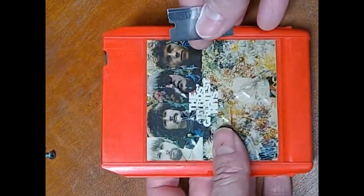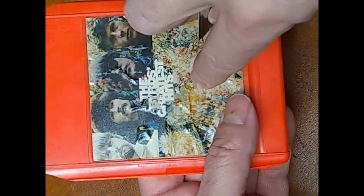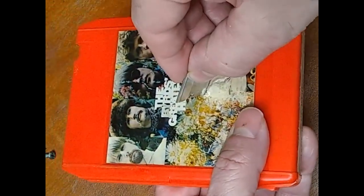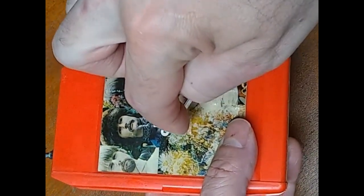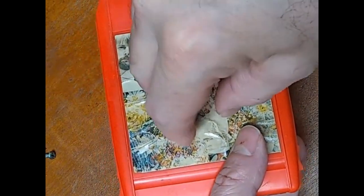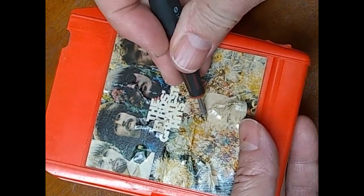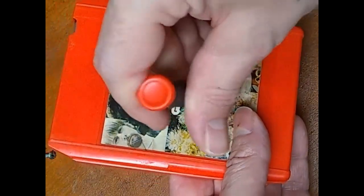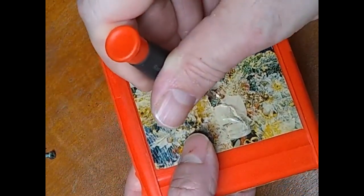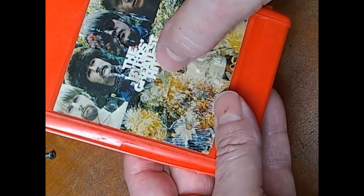I'll show you that one more time. Take your straight edge razor where the hole is underneath — that's where the screw is. Take the tip of it, push it in so that it cuts from one end to the other. Turn it and do it again so you're making an X, pushing down end to end on the circle. Then take your small screwdriver and carefully peel up where you just cut the label, doing minimal damage. Sometimes it works well and sometimes it does not, but this is the best way I have found that causes the least amount of damage.